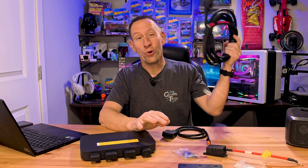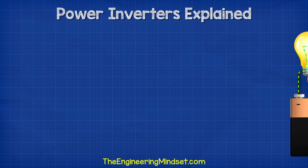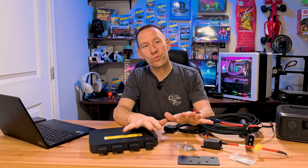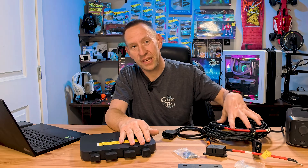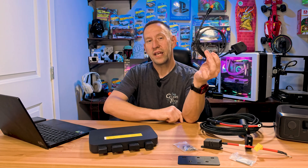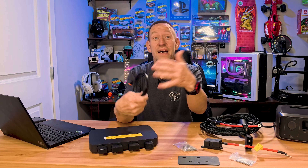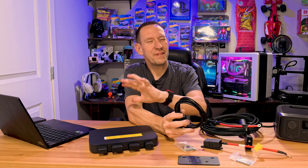The reason the cigarette plug can't charge above 100 watts is mostly because of the voltage — running at 12 to 14 volts — and the wire size, which is generally only set up to run 10 to 15 amps. But this unit has a built-in DC-to-DC converter. The easiest way to boost power is to also boost voltage: pull 14 volts from the truck's charging system, pump it up to around 48 volts, and keep the current through the cable at just 10 amps. Since it's 48 volts at 10 amps, that's 500 watts. The current stays completely under control but the wattage increases — it's almost like magic.